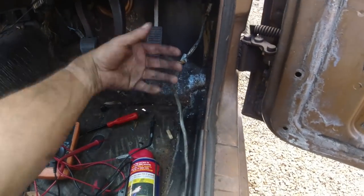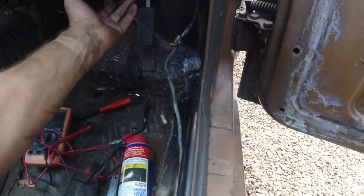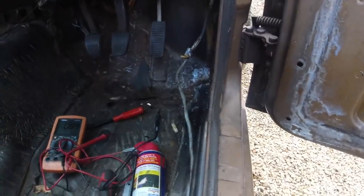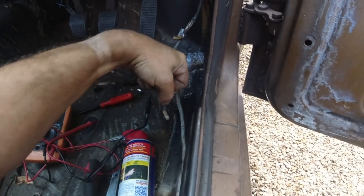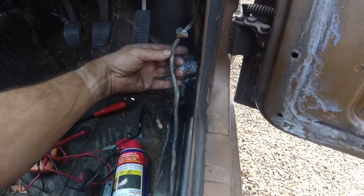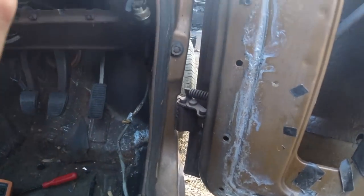When we were at tech school, they used to do stuff like this to us. It was on pinball games. They'd cut a wire in the harness, tape the harness back up. Horrible thing to do to us. But to be fair to the tutors, they'd put the breaks in places where you'd get wear. So they wouldn't do it on a straight run unless it was a cable that could possibly be stretched, and then they would do it. So they used to hide stuff. But what you used to do is go halfway, then halfway between halfway and keep going, and then you break it down that way. It's a lot quicker.